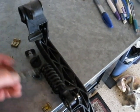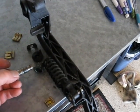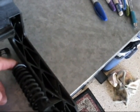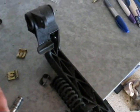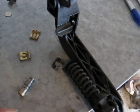Once this comes out, the spring falls out. You don't need to tie the spring together or do anything about the spring, but you do have to remember how it goes back together. The spring goes over this plastic finger, this piece goes on the top, and then there's a metal piece that goes on — and that sits in the bracket and attaches to another metal piece. So you're going to do the opposite of this when you put it back together.